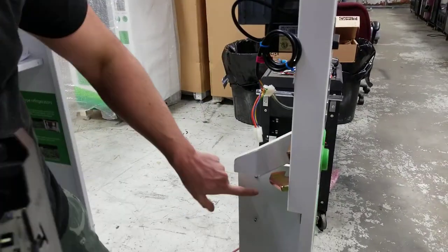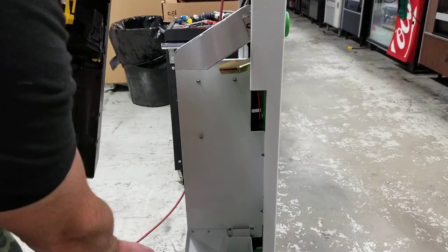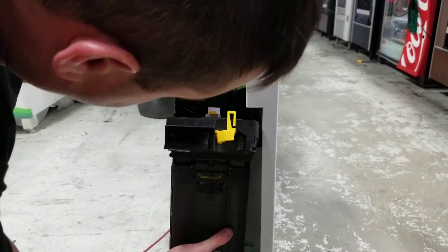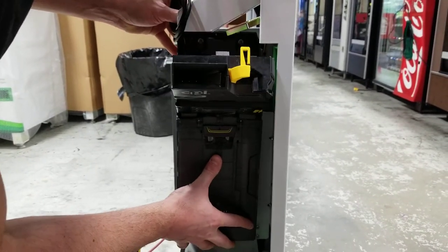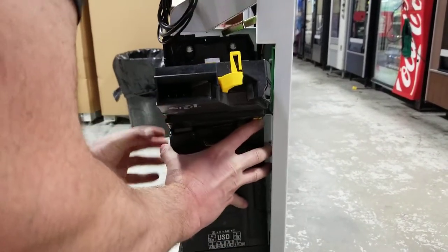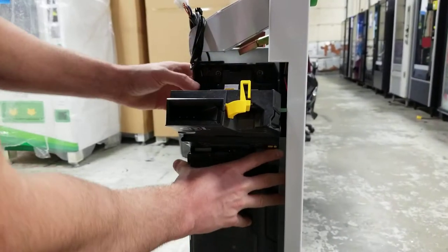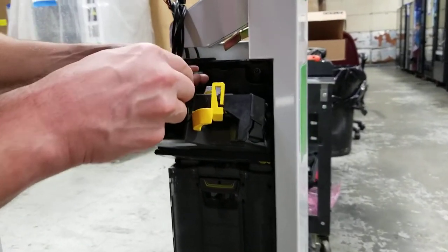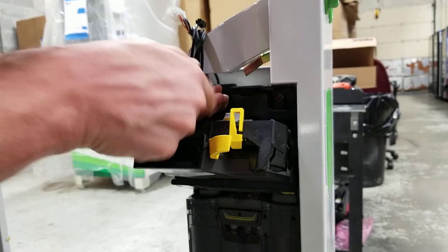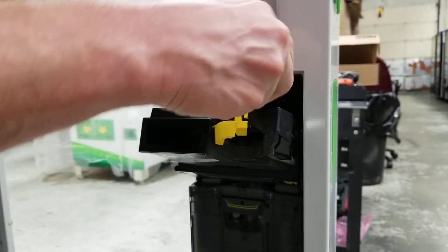To put it back in, you'll see there are three mounting screws. If you have to put one in, you'll see the screws, and you're basically doing everything in reverse. You put these mounting pieces on, just line it up with the holes until they're all lined up and just drop it down. It's already actually on. And what you're doing is just tightening these three screws that we just talked about, so you tighten those up and that keeps the coin mech nice and secure.